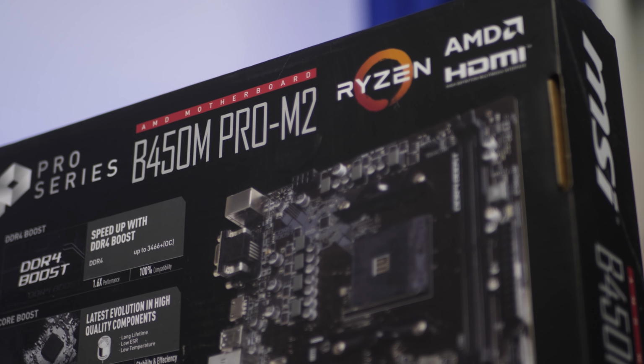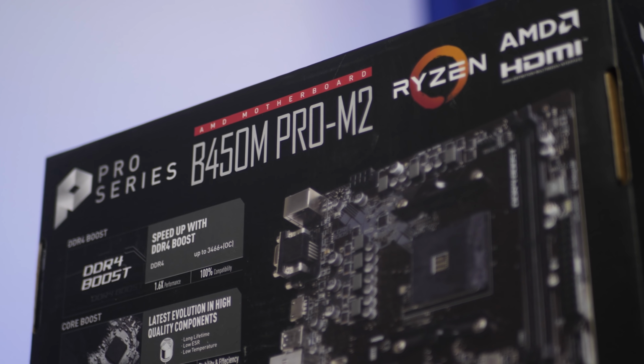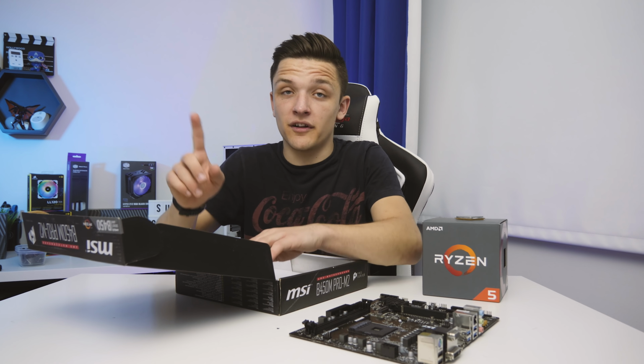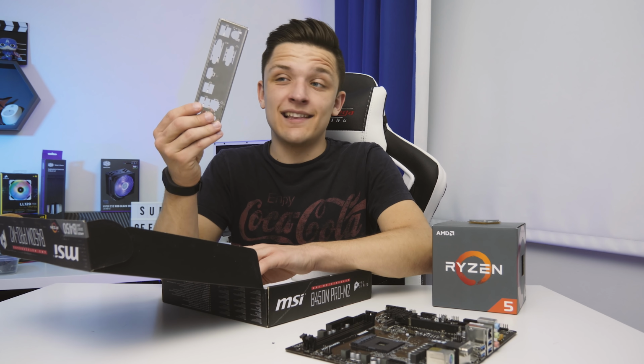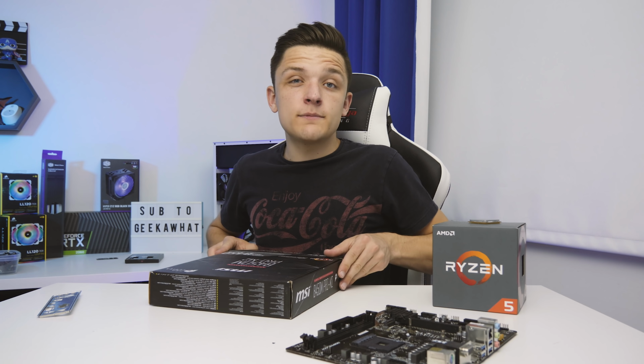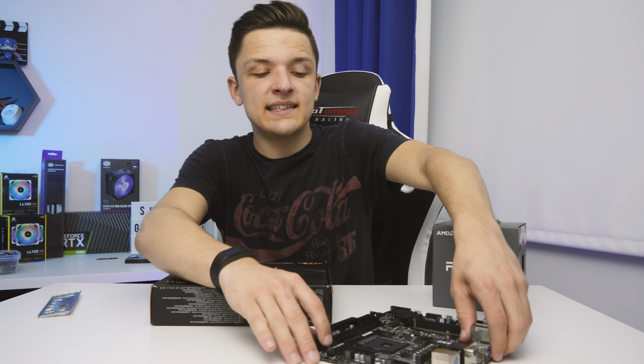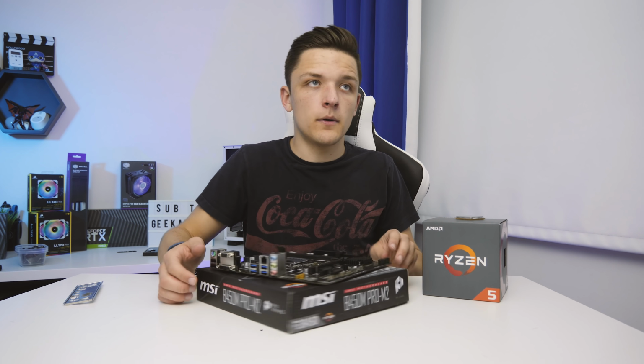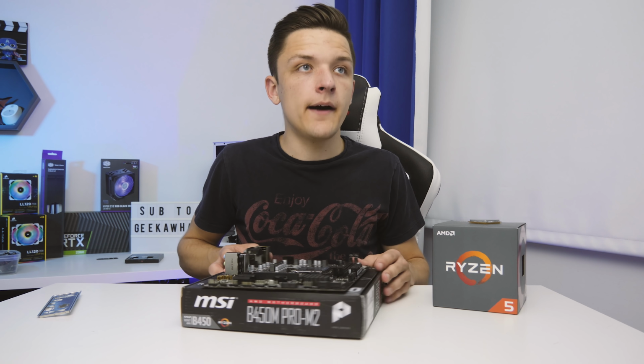Now, installing our CPU and our motherboard is super duper easy. We're going to take out the motherboard from its box and then take out the IO shield, because we don't want to forget to install that. That's this little silver thing here, and we're going to close back up the motherboard and use it as a bit of an anti-static workstation in which we can install our CPU. Just trying to give you the best view over here.